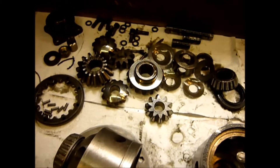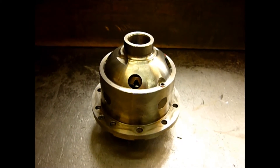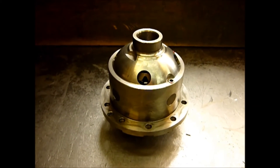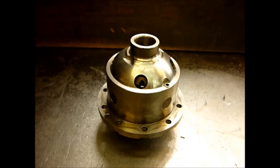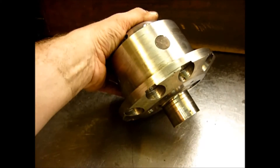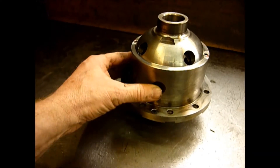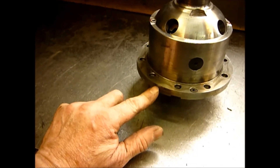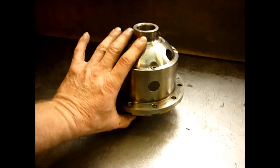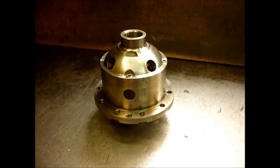To be honest it could just be wear, but the thrusts are all had it, the centre here is not very nice but I think we've got a new one kicking around somewhere — so it needs a lot of loving. So in the words of Sooty — Izzy Wizzy let's get busy! The ARB lives again, although with a lot of money spent on it. So there's a centre tube, complete set of thrusts, a piston, it's going to have seals. As you can see here we've actually decided to turn it down so we can actually peg it straight away. We've got an Ashcroft case that we're going to put it in, which means we need to reduce the OD here to clear the pegging system. Our pegging system doesn't have this problem, so it needs some further new bearings each end, but other than that here we go — and this one won't suffer from it again because we're going to peg it.